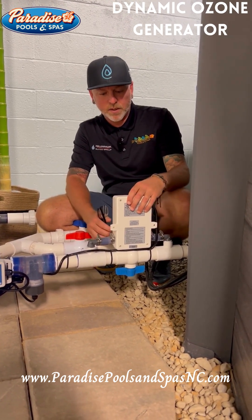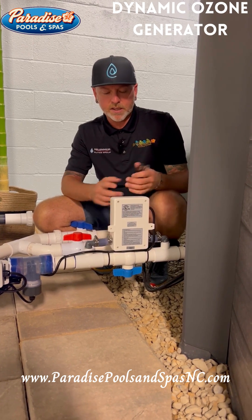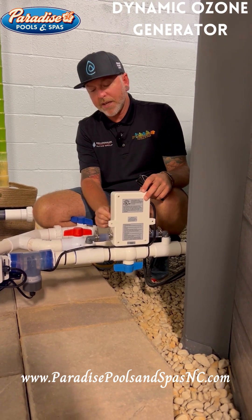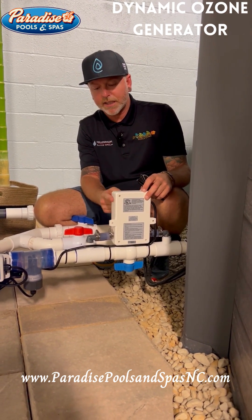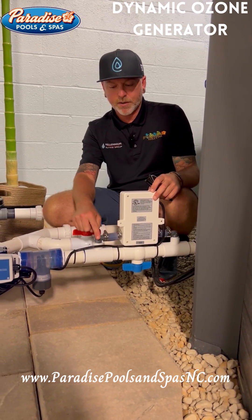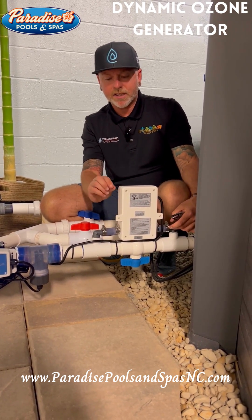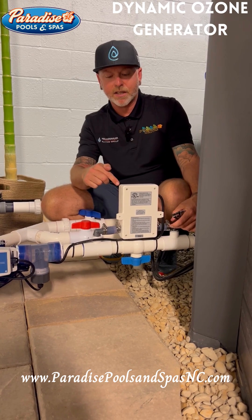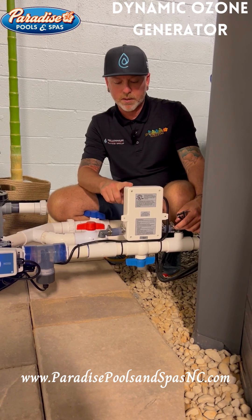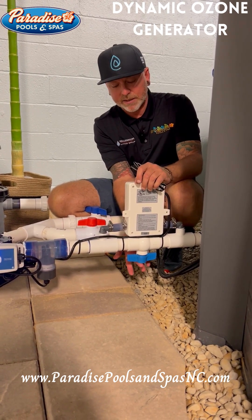So once the O3 is created inside here, how do you get it out? There's a little valve stem inside this unit. The way it draws off air is when you force water into this gray pipe right here and run it through — there's a little pipe inside that draws off the O3 molecule created in here. To do that, you've got to cock back this handle down here.